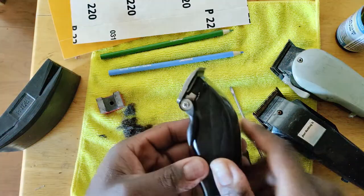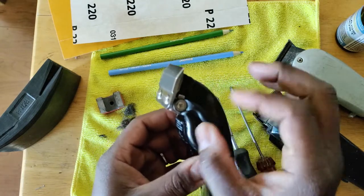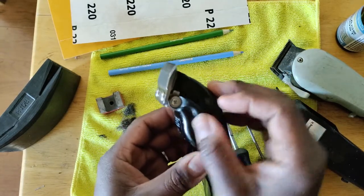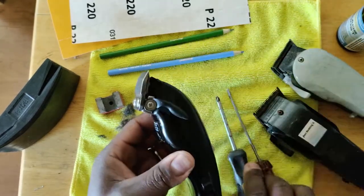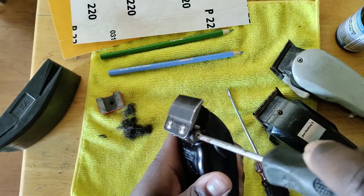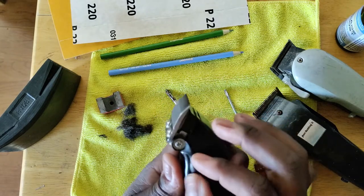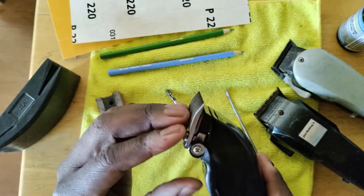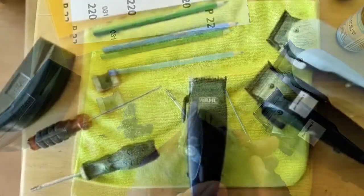As far as the lever, you just want to make sure your lever is not too loose and it moves only when you touch it. If it's too loose, you touch it and this blade will slide back and forth on its own. To stop that, just make sure you tighten this up really good. The blade should only move when you touch the lever. If this blade slides back and forth on its own, up and down, that means the lever needs to be tightened.